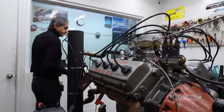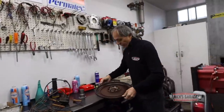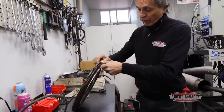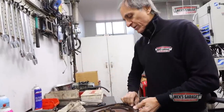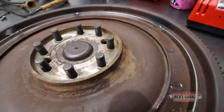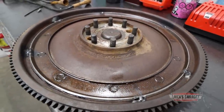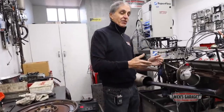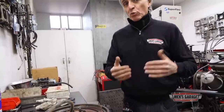And then, of course, this is what comes with the car for the flywheel. It's actually a torque converter. I sliced up a spare torque converter, but then I had to center the holes to go on my friction plate for the dynamometer. Then we took apart the torque converter to line it up. Then I said, you know what? This is not working because this is too big. It's hitting my bell housing for the LA 340 engine. And it didn't work. So then I said, let me try something else. And this is where I thought of putting the Hemi flywheel, because I noticed the 8 studs were exactly like a Hemi. So we got that on.